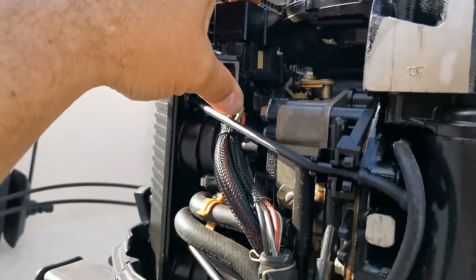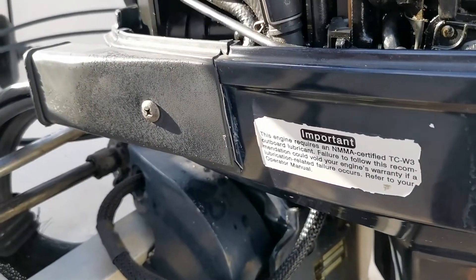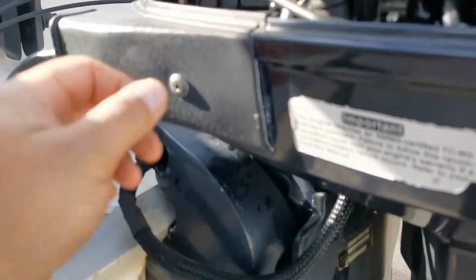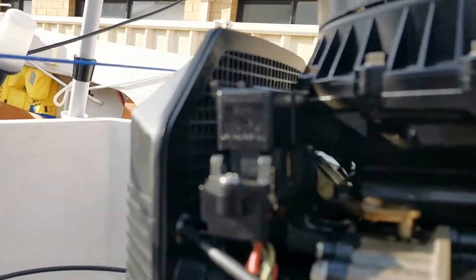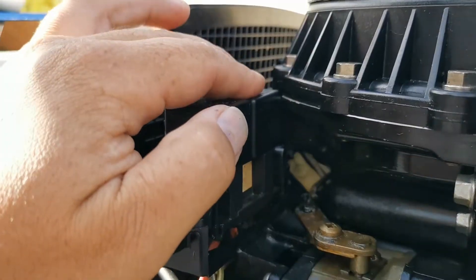The whole purpose of relays is to allow thin wiring on small switches to be switched, then run through to a larger wire gauge which goes to the motor — in this case for the tilt trim. So it goes: two switches, then to the relay, then down to the hydraulic pump. There are two relays regardless of what motor you've got — one for trim up and one for trim down.